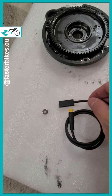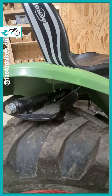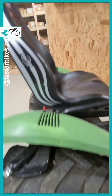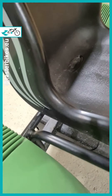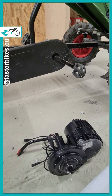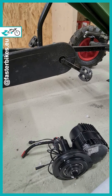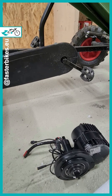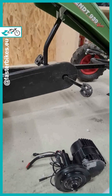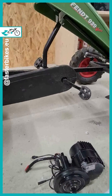The use of a brake sensor could be a possible solution — maybe we can mount this brake sensor somewhere at the mechanical handbrake. Another possibility would be to deactivate pedal support by programming and to enable the motor support only by using the throttle. With this we won't need a safety mechanism. If you have another simple solution, please leave a comment below.